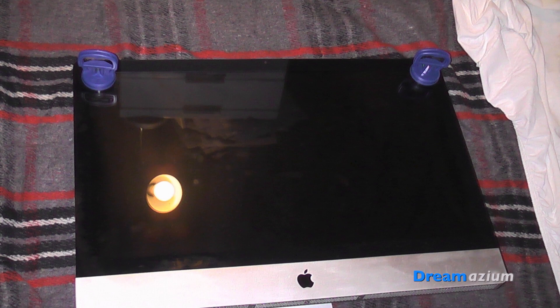Now all I have to do is plug my iMac back in, making sure that it's connected to the internet via the ethernet cable, because as soon as I switch it on I have a blank hard drive in there. So I'm going to have to connect to the internet — it will automatically recognise that it needs an internet install. I will get a glowing ball, I'll select that, and then it will give me options like utilities and I'll be able to take it from there.